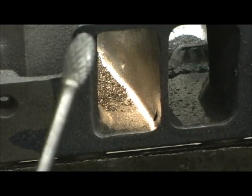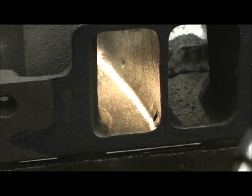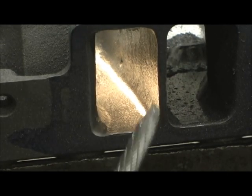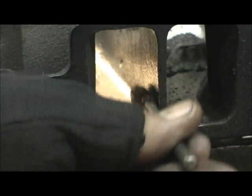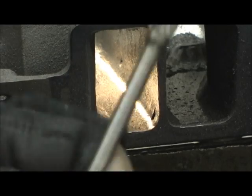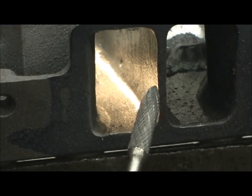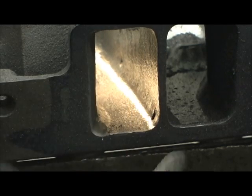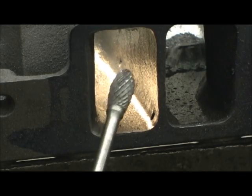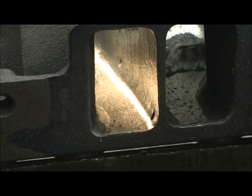I'm going to show you how the trenches roll. Believe it or not, this is the next to the last step. When I'm completely done and really get the texture smooth, I'm going to go in here with a straight and roll it in — and this takes what little bitty bumps are left. I leave the head with that finish. I do not polish this any smoother because I do want some roughness to atomize the fuel. That's how it's done — blending with this, taking the trenches out, getting it rolled in before I do the measuring.